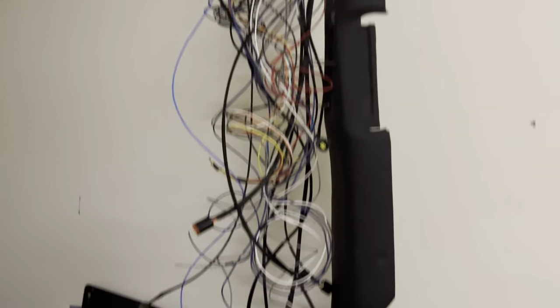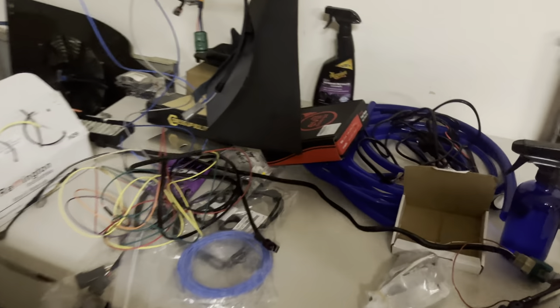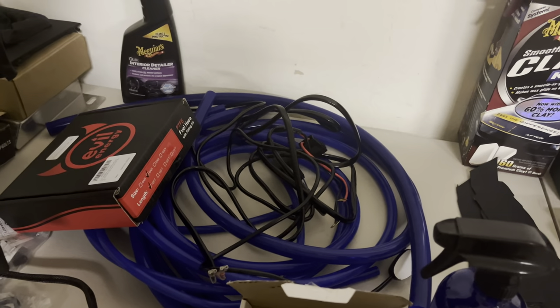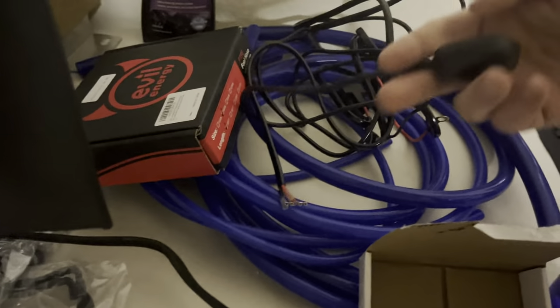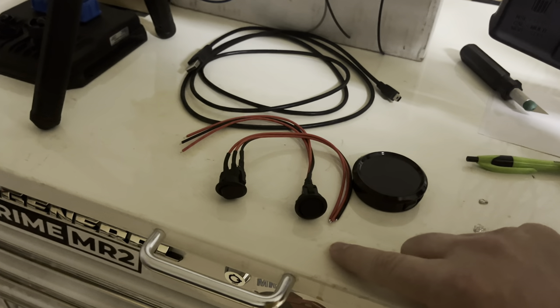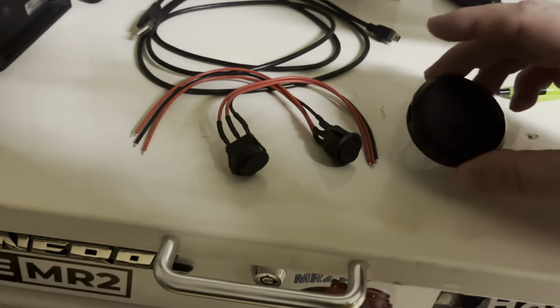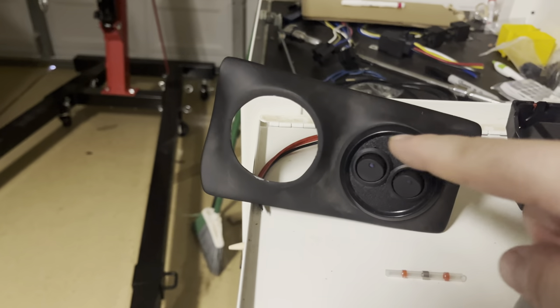I think these are all the looms I've created — there's the starter section, and that should be all the wiring I'll need. I'm also integrating the dual cooling fan wiring for the engine shroud with two Spal fans. I still need to paint the engine cover so I haven't put that together yet. This came from MR2 Heaven. I'm going to replace their included switch with one of two small blue LED switches I bought — a pack of 10 in five colors for about six dollars on Amazon. The blank was also about six or seven bucks. Got the switch pod done — that'll be the intercooler and engine lid fan.